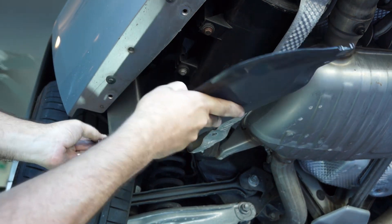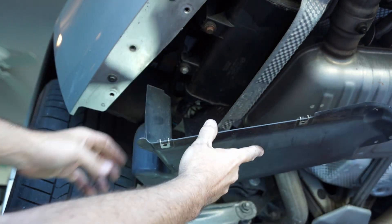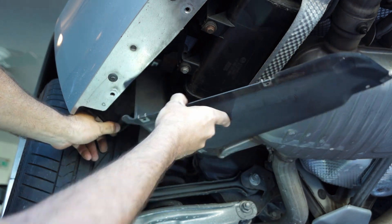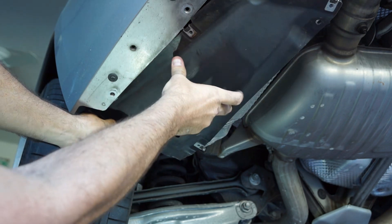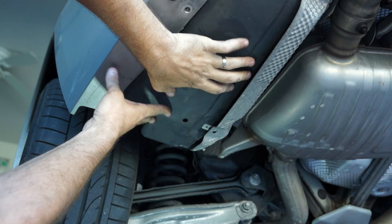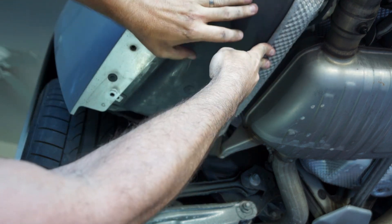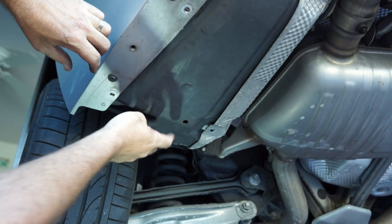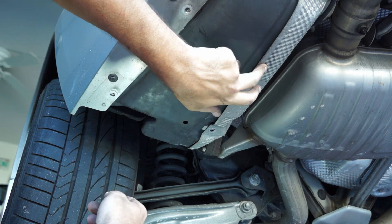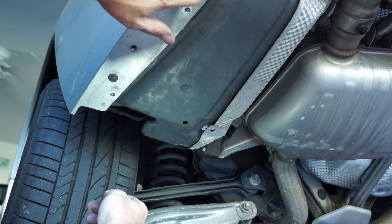For this plastic piece, you have it out of the car and fit it up at an angle like this. You move this piece in the fender well out of the way and then twist it as you put it back in. Make sure it goes back into place — it should sit on top of both this metal over here and on top of the plastic from the rear bumper.